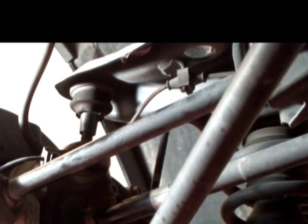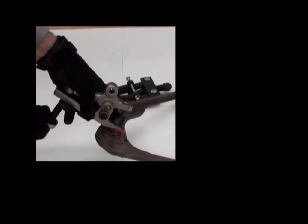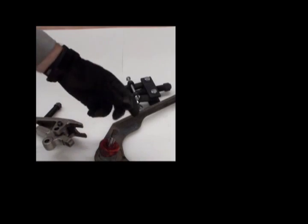Break the taper to the knuckle and remove the ball joint stud from the knuckle. Note: the taper adapter should stay with the knuckle. To remove the taper adapter from the ball joint stud, use a small gear puller and remove it — reuse the adapter.